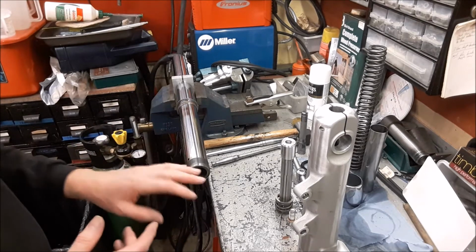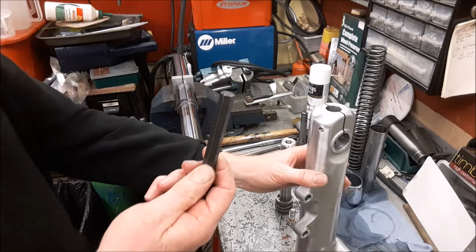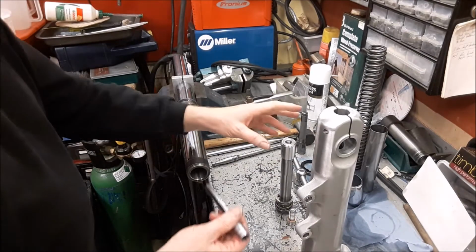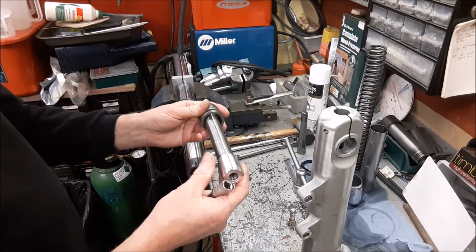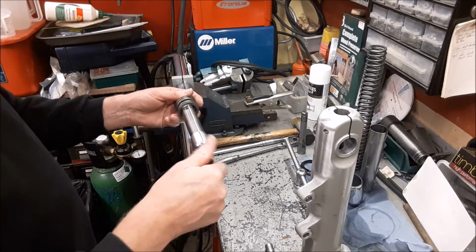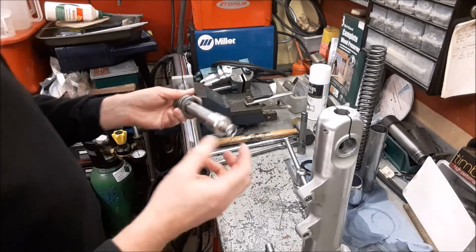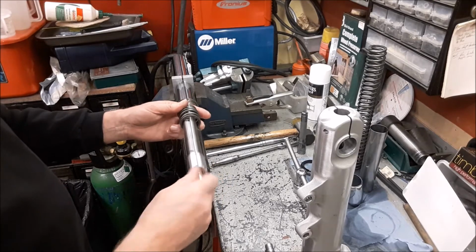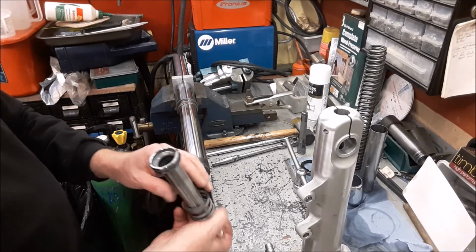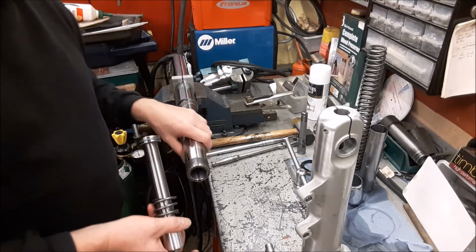So when I came to trying to get this off on Saturday afternoon, obviously long Allen key into there, undo the bolt, but the whole assembly was turning inside. So obviously that bolt sits in there, and I assume because it's got the thread lock on it, the whole assembly is then turning, and I couldn't get it undone. There's nothing to get hold of. There's no way. This is buried down inside of the fork tube itself.